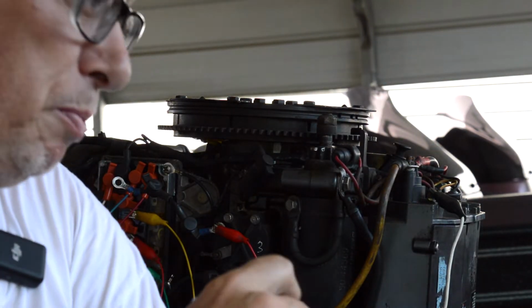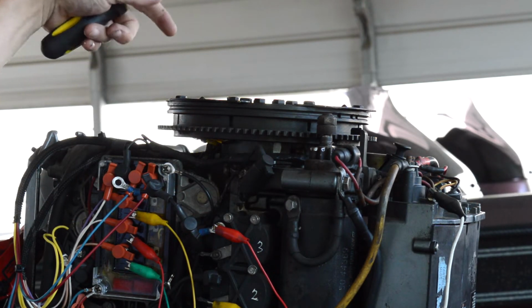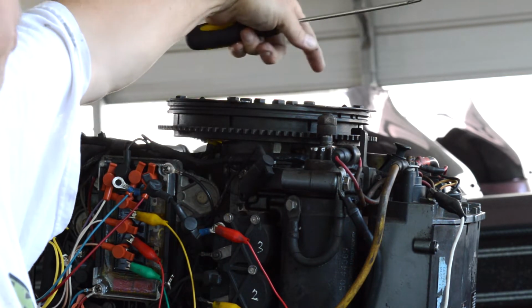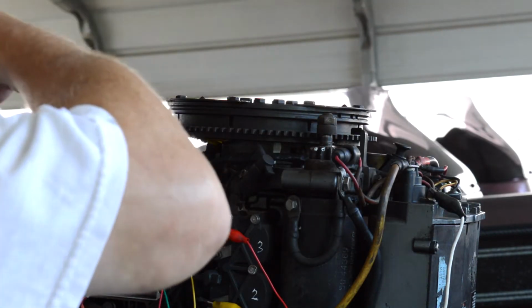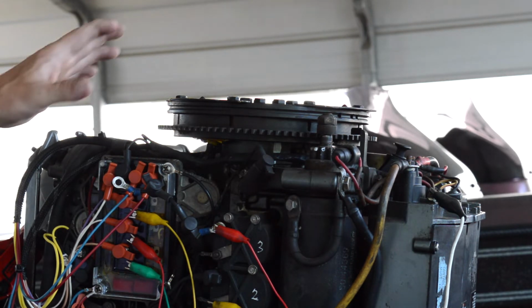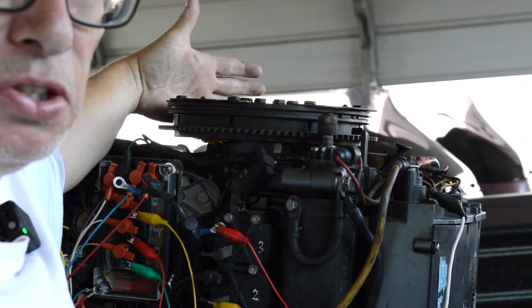So I'm just doing this because I have this on number 1, so when I do the timing light, it should show me number 1. I can point up here and see about where it's triggering. And there's probably no way to really show you this. I wish there was. I could try to get the camera up and shoot down and see if we can get a shot of that. But my goal is to figure out where it's triggering and why it's triggering where it's triggering.